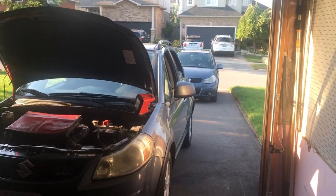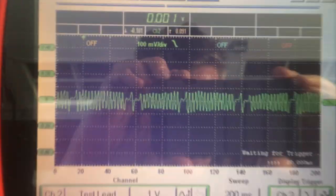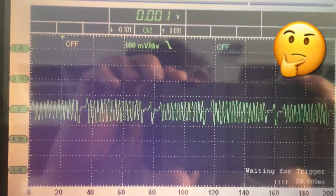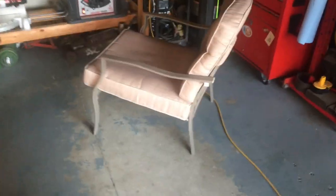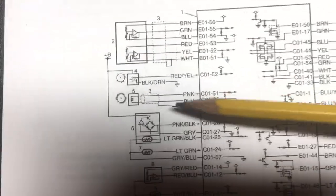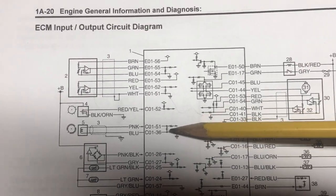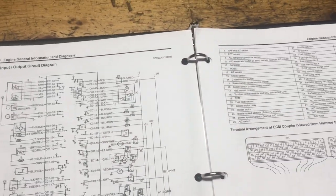Let's roll in the other SX4 and scope the crank sensor again to see what the story is, because I must have done something wrong last week. Back to my other car — check out the peak-to-peak values on the crank sensor on this one. There's only a single pin probe on the ground so there's definitely no shorting on anything. And that is a tenth of what it is on the other car, yet the signal is clear. I wonder if for whatever reason the crank sensor signal internally in the ECM goes across a dropping resistor. Did they change this between model years? That's possible, but that's not what the manual says.